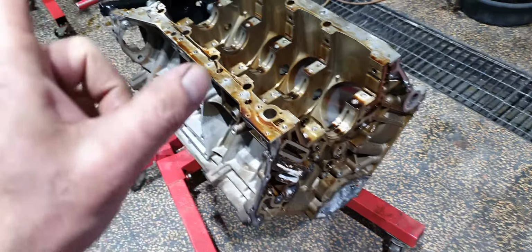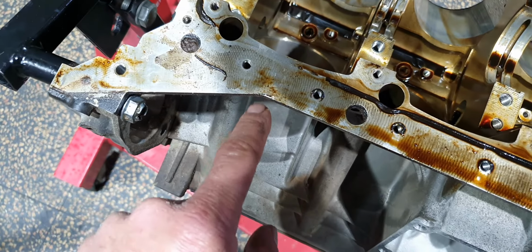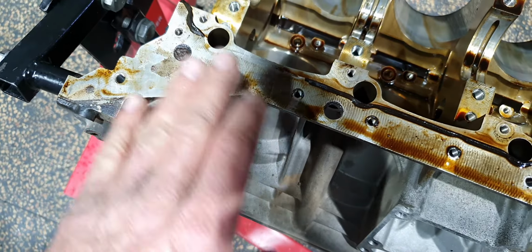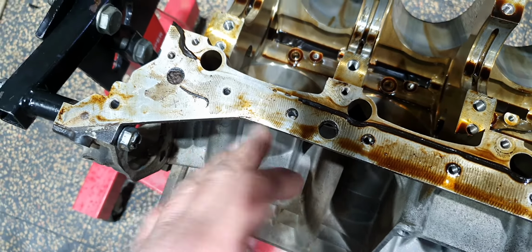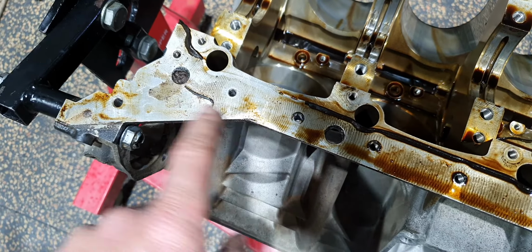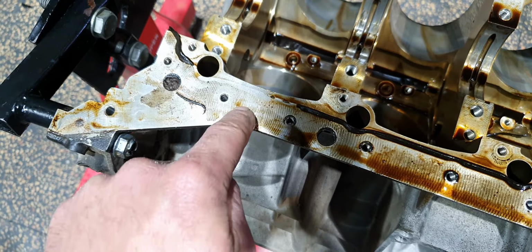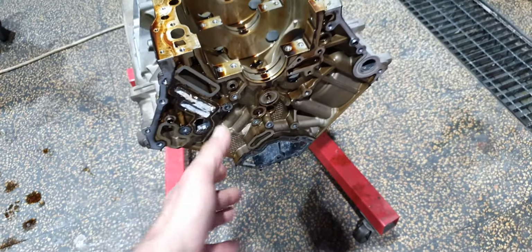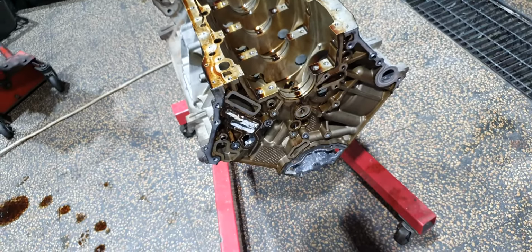this block. By the way, when they opened the oil pan, they hurt it here. You don't open the oil pan like that. You don't put a screwdriver or pry bar here. So what I did, I filed it a little bit because it was raised, it was more up. There is no problem, you're not gonna have a leak or any effect, you're only gonna see one small imperfection here. This is not by me. You see the timing cover on all these things, there are no scratches on the deck. When I clean it, you can see that there are no scratches.